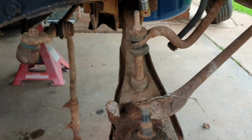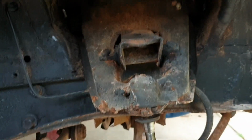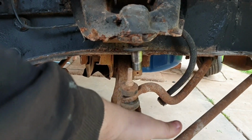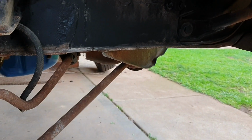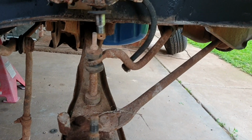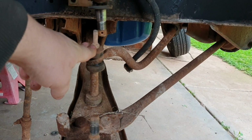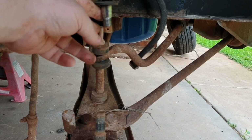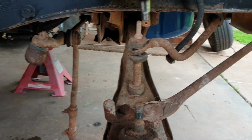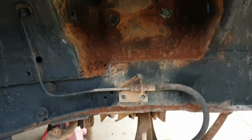So yeah, busted the ball joints before. This is now free as can be. So I'm going to undo the 2 bolts in there. That'll fall out. I'll get under here and undo these, but I might try and get the nut off that end first, because this will hold that so you can actually undo it. And then we'll try and undo the sway bar, and then lastly we'll try and undo the camber bolt and remove the lower control arm. So stay tuned.